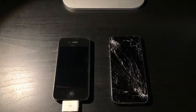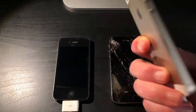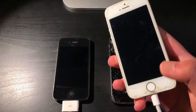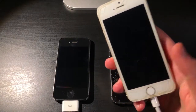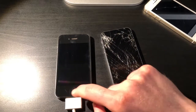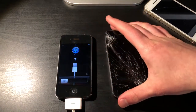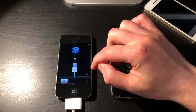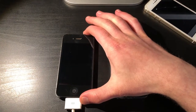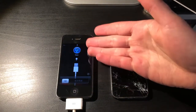If you've been following the channel for a while, then you might remember this — it's another 5s, a gold variant, which is also on iOS 9. Now this one I believe is on a later version, but we'll have to check once it actually powers on, so we'll leave it off to the side. But the iPhone 4 has actually powered on. It seems like the home button doesn't really work, but it does power on, and it's at the recovery screen. Since this is an old version of iOS, there should be a pretty easy bypass for this, and at the very least we could see which version of iOS this is.